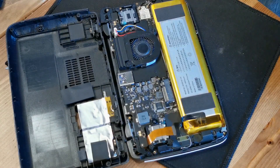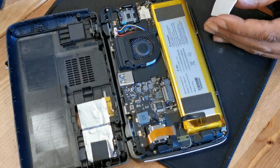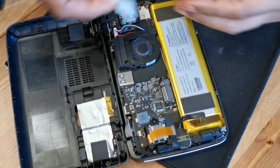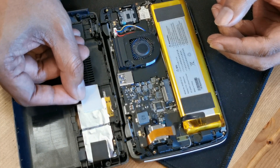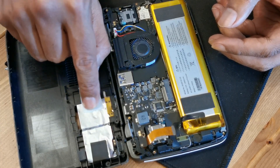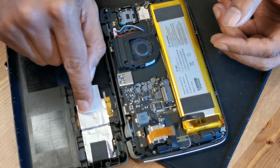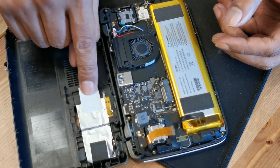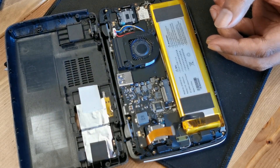After that we remove a rubber pad and place a thermal pad on it, so the SSD will be cooled a bit better. You can see the copper — the aluminum plate is now touching the cooling copper, so the heat will flow to the cooler.